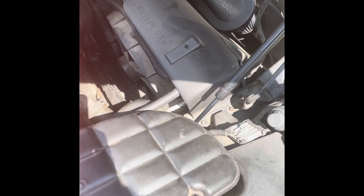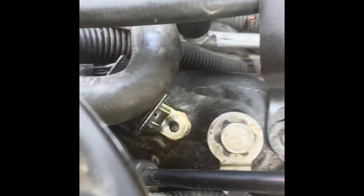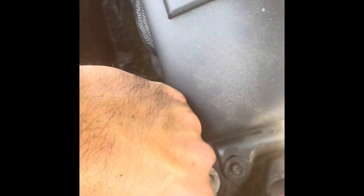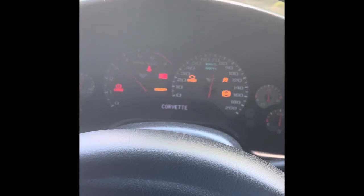So now let's head over to the passenger side where the coolant tank is. You'll have a ground right there — another 10 millimeter. Let's pop this ground off and get to work on it. The passenger one was a mess, but we cleaned it up, sanded both surfaces and the back of the nut, and put it back on. Battery is reconnected, passenger side ground is cleaned. We're going to end the video there — that's going to be part one. Tune in next time for part two where we clean the rest of the grounds. If you haven't yet, please subscribe to the channel, hit the thumbs up button. Until next time, dad life.